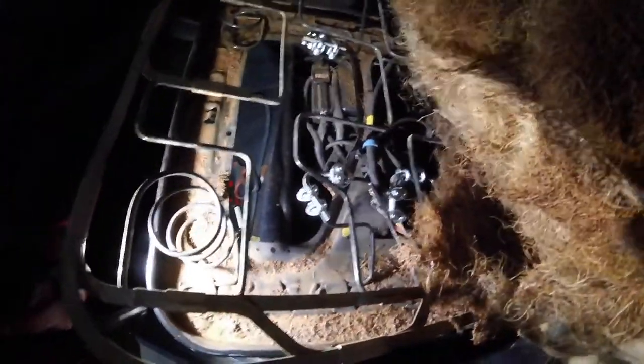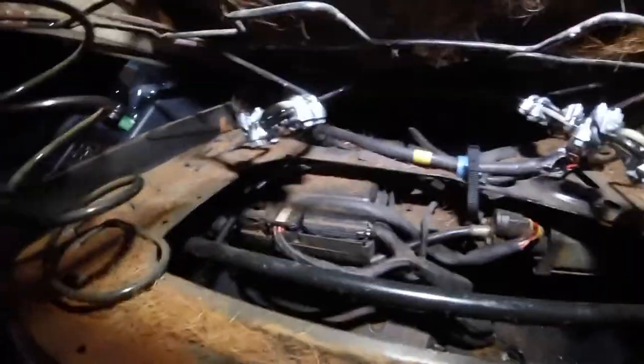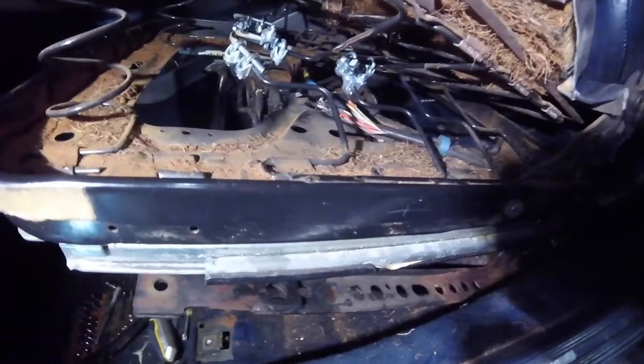Some of the stuff I'm doing this weekend — I had three broken springs in here, which is probably why my back was hurting a little bit driving. What I did was just splice some bars in here. I bought some bars at Ace Hardware — I'll link the size down below. I just used saddle clamps, two on each side of the bend. It looks pretty good and it's definitely strong, definitely working. Overall, definitely a lot better and it's holding. Put the seat back together and cross it off my list.